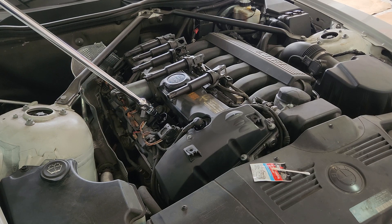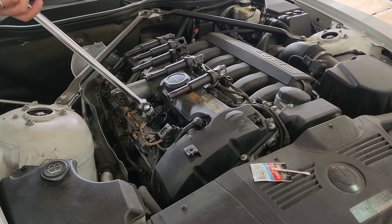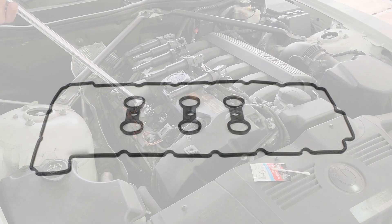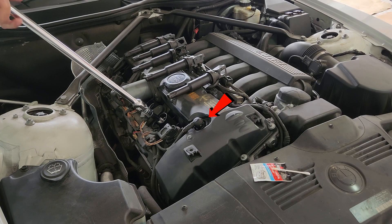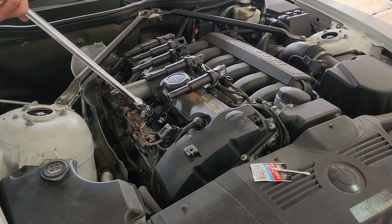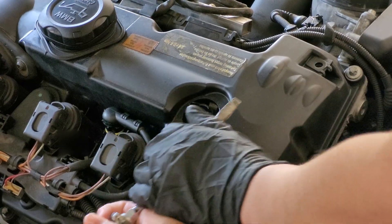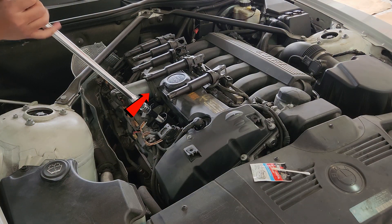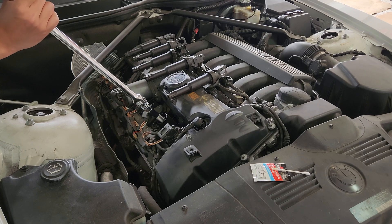Also, if there's a pool of oil in your spark plug hole, that could be related to the gasket in the hole that is usually replaced and comes with the valve cover gasket kit. There is also a gasket here next to the electrical connection, which can be replaced individually, and I have a video for that too. Then there's the gasket here around the actuator, so check around that and below for oil.